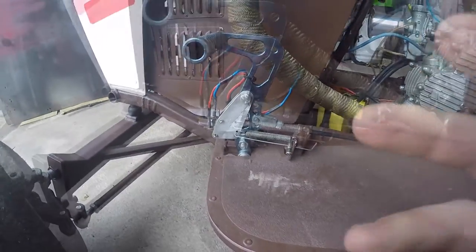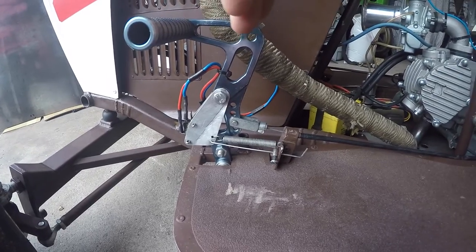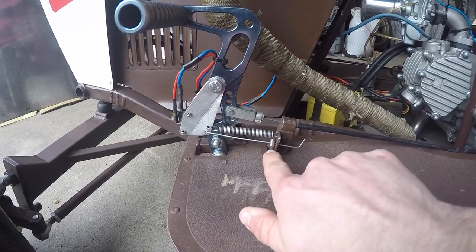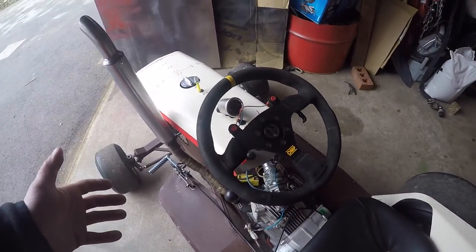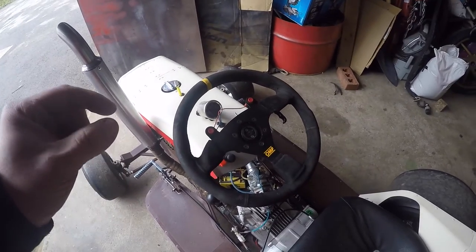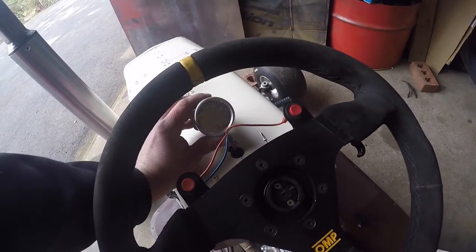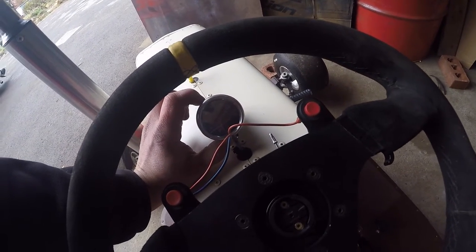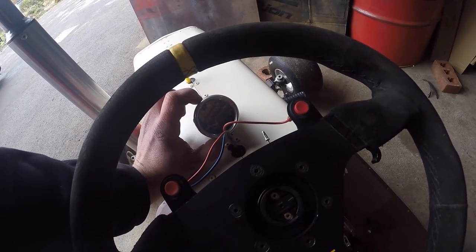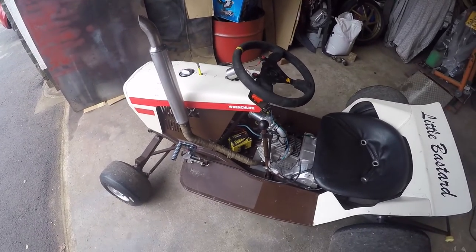That's your mechanical element. When setting the two-step up, the first thing you do is find the bite point of the clutch and adjust this so that it pushes that away when you reach the bite point. After that you do a few launches, adjusting the low-end rev limit until you find the sweet spot. As a feedback instrument we use this tachometer here, which lets us know what the engine speeds are so we get a better idea of what we're setting it up to do.